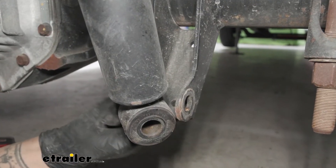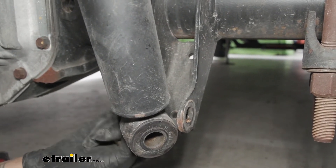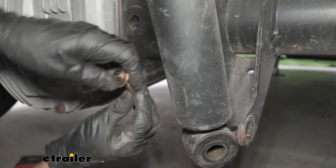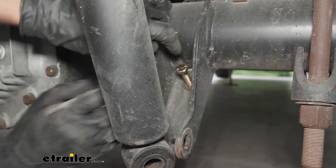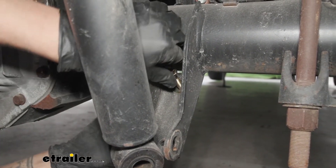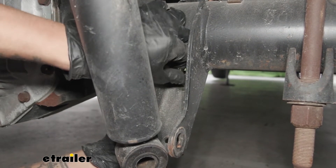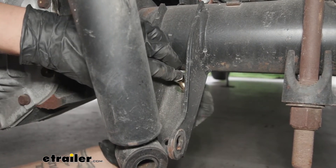If you look inside that shock mount, you'll see that we have two holes — one towards the axle up top, and one towards the ground on the bottom. For the top hole, we want to grab a three-eighths bolt out of our kit, follow it up with a flat washer, and we want to go from the inside pointing out, going towards the ground. It is a little bit tight, but typically you can push or thread that bolt in to get it to go all the way through. Once you get a little bit of it sticking out, you can grab it with your fingers — it will be a little tight — just thread it in to start, and work it the rest of the way through so it's completely coming out.